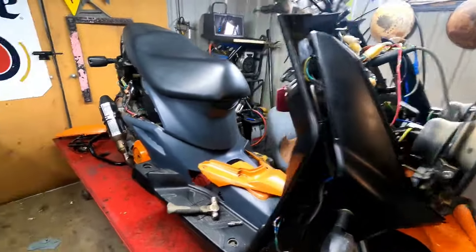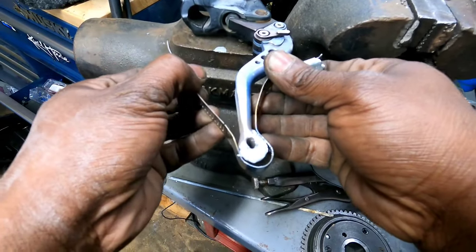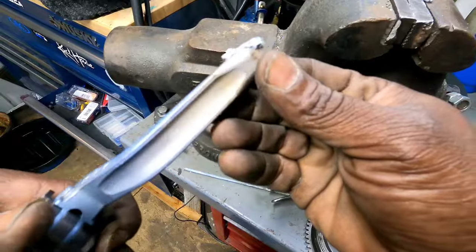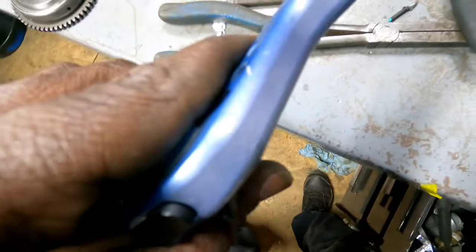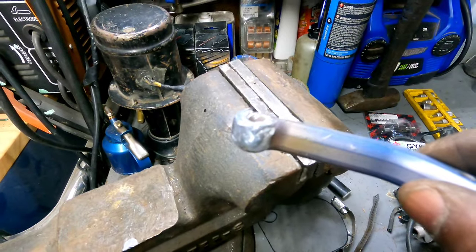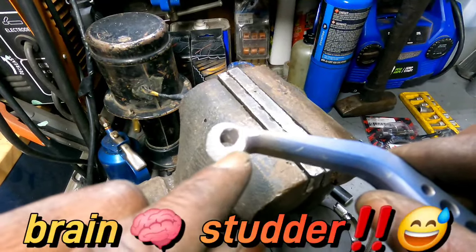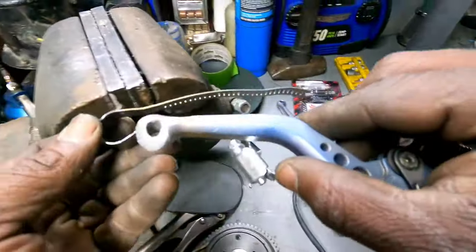Check this out gang — here is our brake lever. Let's take off the hose clamp and see if it stuck. It's on there and it is ugly, but we're going to shave all of that down. It worked — built up that aluminum. I'm going to take my flap wheel to it and get this thing some shape. A few moments later — looking real good, things are going real well. Then I went to drill a hole through the middle and it just popped straight out. I'm not going to give up. I'm going to drill a couple small holes around it, find a bolt that can go up the middle, put the strap back on, and try it one more time.